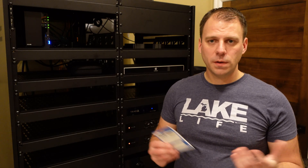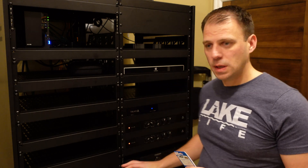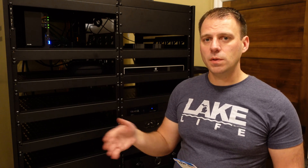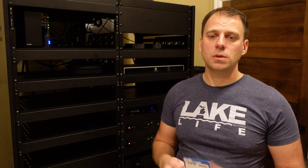A newer aspect of my setup is this multi-zone concept, which I've referenced in a few prior videos. I'm using one single audio processor — in this case my Marantz AV7704 preamp — to drive my main zone, which is my theater space, but also to treat my living room off of the same sources and the same preamp as a multi-zone zone 2.